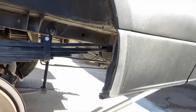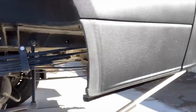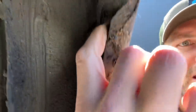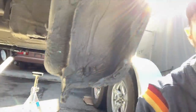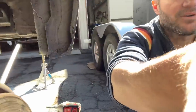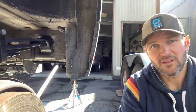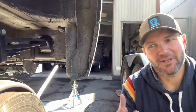So what's going to happen — you see kind of this area where there was dirt behind the mud flap. What we're going to do is measure like I said, inch and a half there. You see how this is kind of hollow back here — so you're going to trim that out. I'm going to leave a section up here that we can screw to, and we will cut that out so we can fit our bigger wheels and tires.